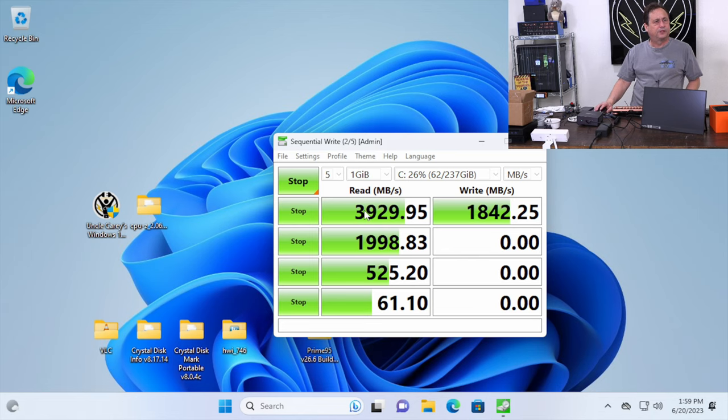Yeah, the write speeds on this is not good. It's a shame that almost universally, the mini PC manufacturers are putting in bargain basement NVMe drives or solid state drives in general that hinder the performance of the unit. So I can tell you right now, if we replace the NVMe drives in this, it'll run faster, even though it's pretty fast right now. These drives are holding the performance up of this unit, just so you know. So it might be best to get a bare bones unit if you're worried about that. You want to get the best performance out of it.